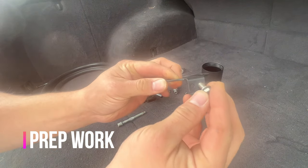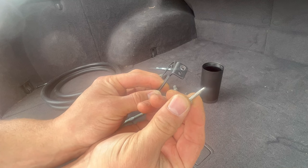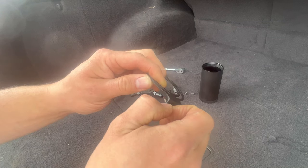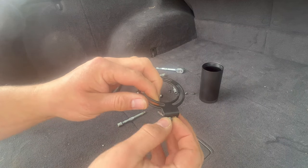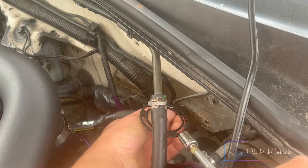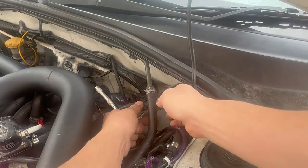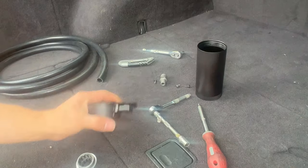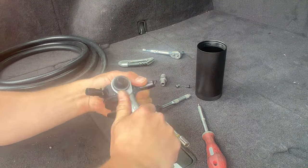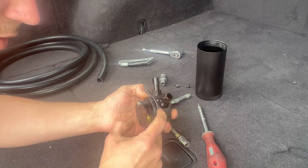So I've just opened it out to 6.5mm so I can get my nice M6 fixing through. I don't want to put two new permanent holes in the car, so let's use a proper bolt and get it mounted. Now would be a good time to get these port fittings tightened up — you don't want to do it once it's in the car. I can't see them leaking, but if they do I'll put a bit of sealant on the threads.